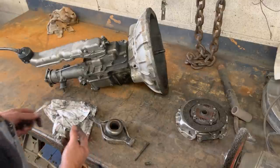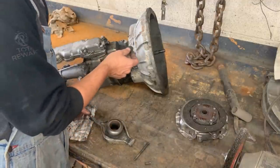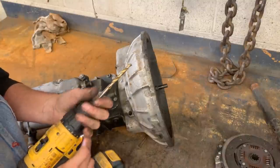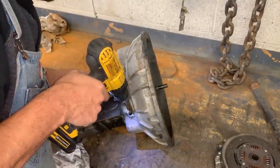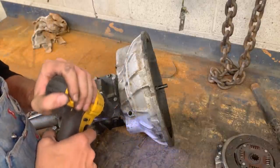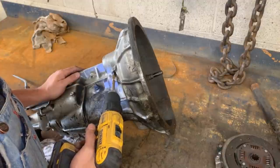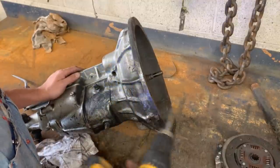And I know that would be great if I can do it on a mill or something. I don't have this luxury, so we're gonna try to drill it with a regular drill by hand. It's 310 thou, and we have a 310 thou drill bit. Hopefully we can go all the way down, which I don't know. Not really. I have to go for the other hole from the other side. That might be a problem about concentricity, but it is what it is. Holy crap. It actually went through.